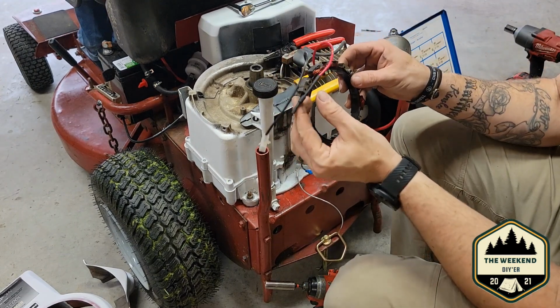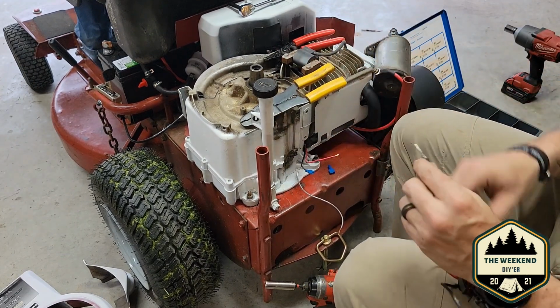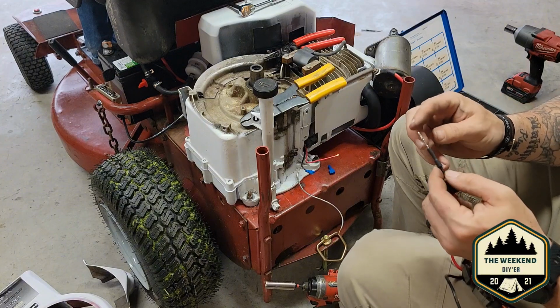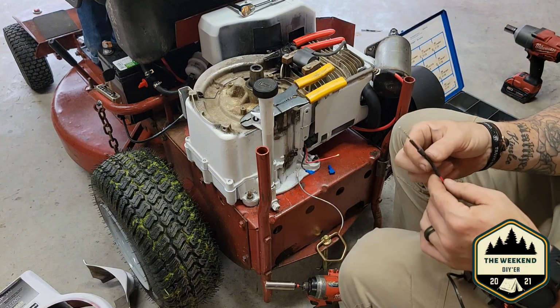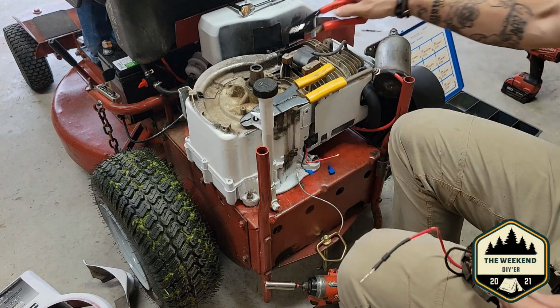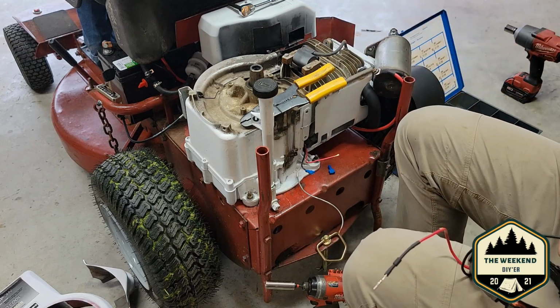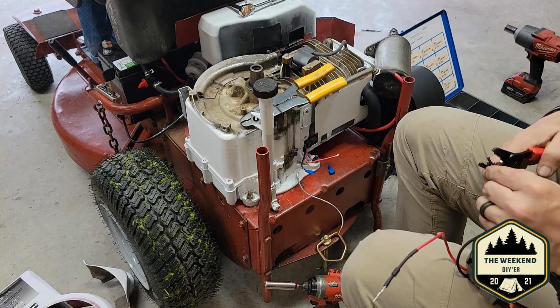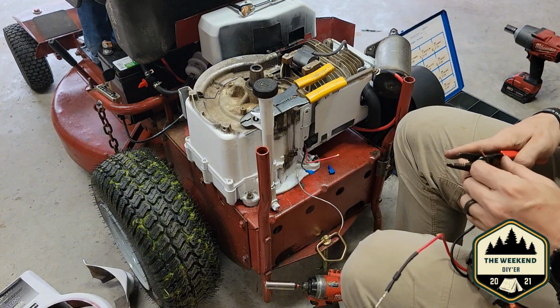Guys, so I was able to get that out, as you saw. That wasn't too bad, but the whole reason for that, I know it sounds silly, is I want to save as much of this as I can because, like I said, there's a diode in there. So the ground wire though, it doesn't matter. We can just clip it right off of there. And we're gonna go ahead and get it spliced up and get our butt connector put on it.